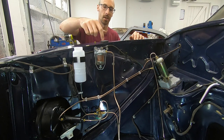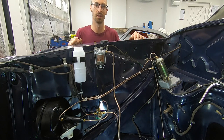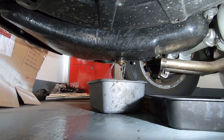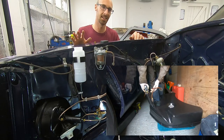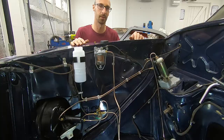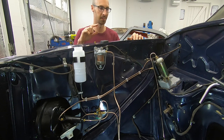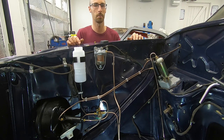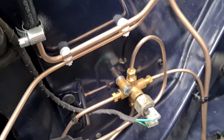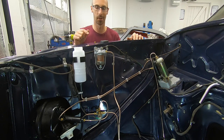When I took a quick look at the fuel system — this old filter which we will be replacing — I noticed it was absolutely full of crud and rust from the tank, so that was another job for the list: drop the tank out and seal it all up. We did try this before in a previous episode but we didn't actually seal it — we just tried to use some rust converter and shook it all around, but clearly that's not good enough so I put some sealant in there and fingers crossed that sorts it for good. I hope you had fun on this episode — brake lines was a new one for me and when you take a step back I'm really pleased I did it because they look so much better than before. In the next episode we're going to be getting ready for the engine to go in, which means doing everything else that needs to get done in here. So that's it — we'll see you next time on VIX Projects.